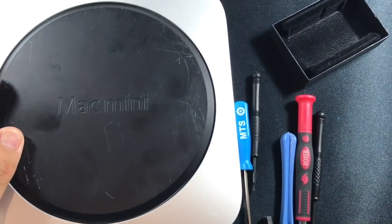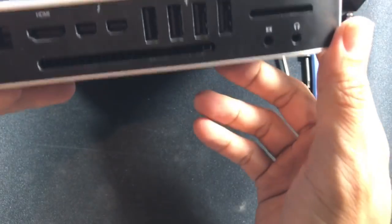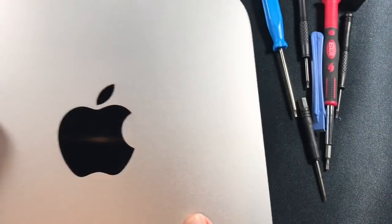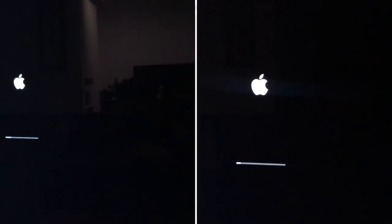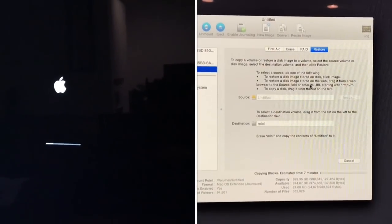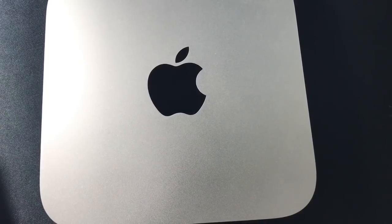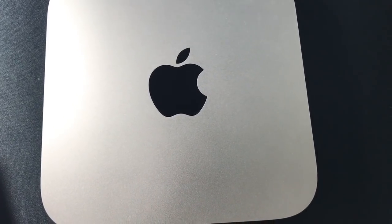Now that that's done we just put on the dust cover and it's pretty much all set. We just look it over — no scuffs, no scrapes, can't even tell I opened it up. Now we're going to boot it up and I'll show you side by side what it looks like before and after. You can see that the one on the left is really slow and the one on the right is the SSD. To clone the drive, all you have to do is use one of those USB enclosures, hook it up to the Mac with the disk, open up the disk utility on boot, and do a restore — setting the destination as the new drive and the source as the old drive. Once you're done, unplug it and reboot. Thank you everyone for watching — please comment, like, and subscribe.